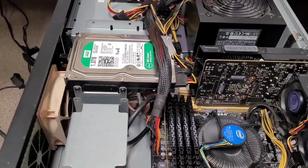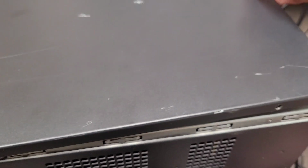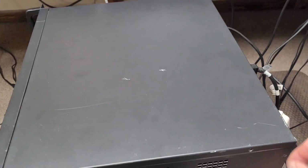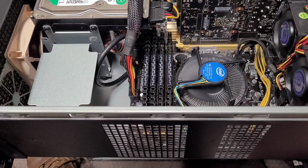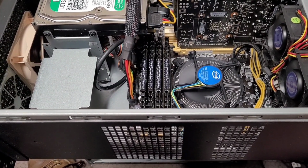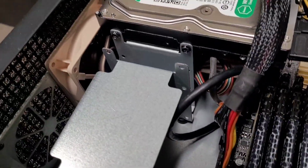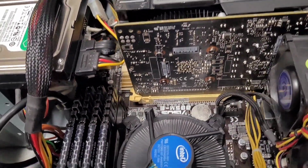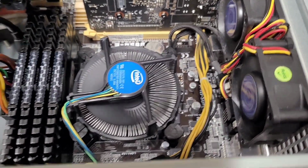Fun part will be putting the cover on, because right now it's getting the advantage of ambient air flowing through here and cooling it down. With this on, now I'm hotboxing that CPU, because there's really nothing airflow wise. It's kind of trapped in its own little valley. I'll have to look and see. Maybe I can bum a better heatsink off a friend. Do some trading. Because yeah, I got that front intake fan, and it's blowing everything into the memory, and then the graphics card, and these 2 little sad fans here are sucking hot air out, hopefully.